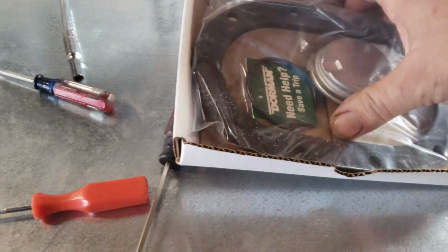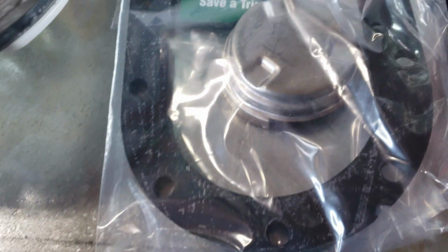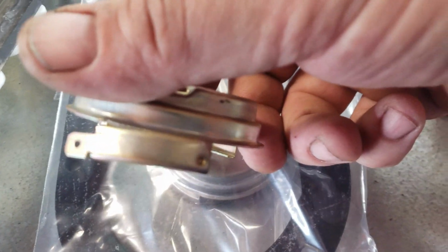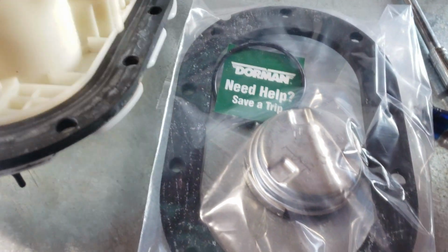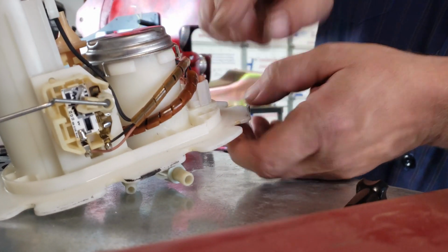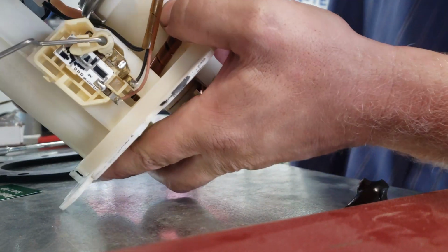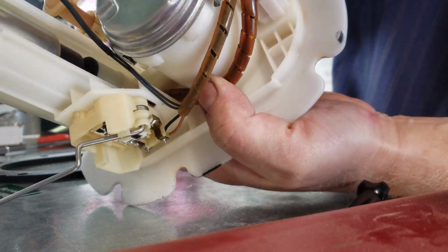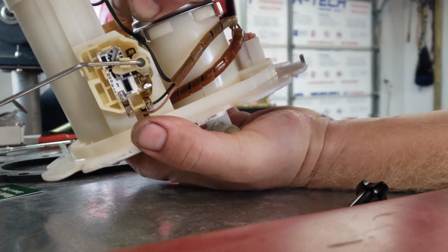All right, here's the new part. It got tap, O-ring. You can see the old one here, split apart. No bueno. But let's get the new ones on. So just, O-ring is pre-lubed, so just get it on there and kind of evenly squeeze it down. Make sure it's not popping out of any of the sides. And hopefully we can get it to just twist in.